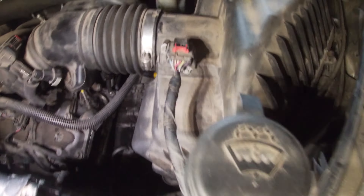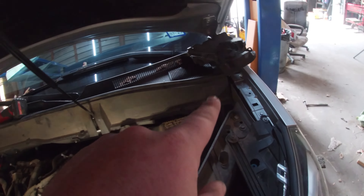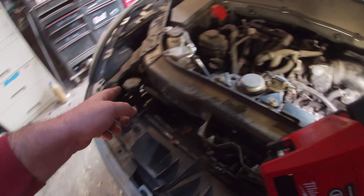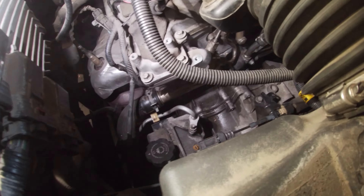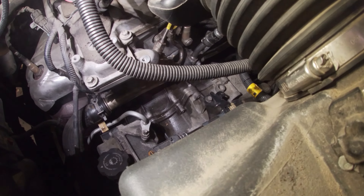Everything is buttoned up. I don't see any puddles forming on top of the transmission — that's good. I want to fire the car up. The radiator is topped off, the cooling reservoir is filled, and I just want to make sure with that sticky gasket that we don't have any leaks. Got it idling — there's a little bit of smoke from coolant on the catalytic converter that'll burn off. I don't see any leaks currently. I'm going to let it run until the thermostat pops open, and then fish the engine cover back down and get it reinstalled — it just sits in there with the 10mm bolt. And then it's time to test drive. If this video helps you out, hit that thumbs up button and subscribe if you want to see more repair videos.